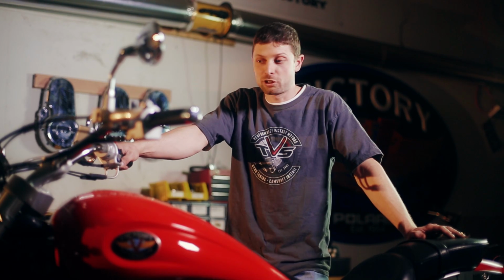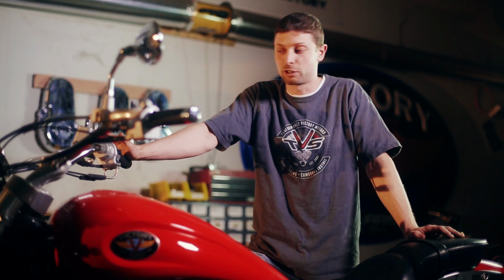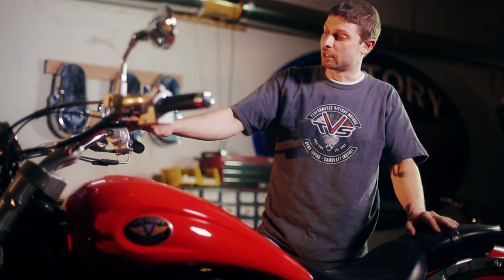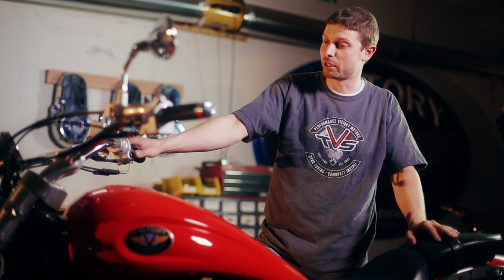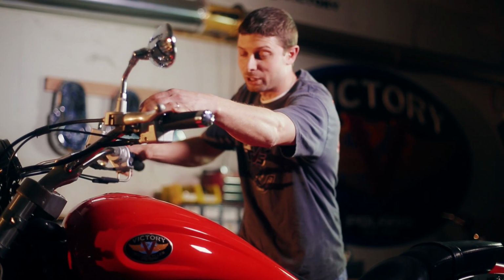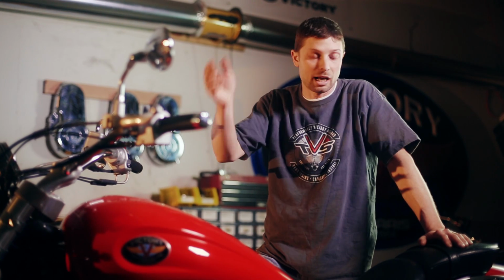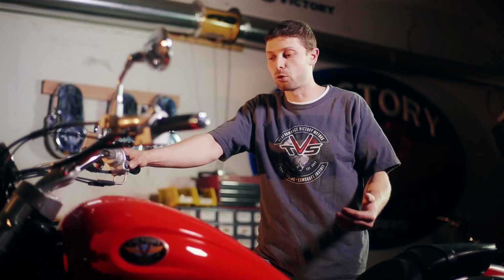Okay, one last thing before I let you go is the start procedure. I know I've hit on this a couple of times through the video, but I find that it's the least known part about operating this year of Victory. So again, we'll flip the key on, kill switch on, and then with these 4 fingers, we're going to crack the throttle just a little bit, and with my thumb, I'll hit the start button. Once it's started, I'll pull the high idle lever up and let it come up in idle so that it warms up. Typically I'll walk away, finish my cup of coffee, and let it idle at a high idle, maybe 1,200, 1,300, 1,400 RPM for a few minutes just to get the oil warmed up and to avoid running a cold motor hard.